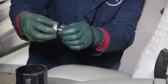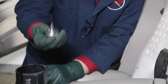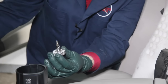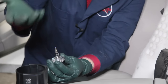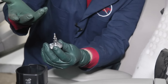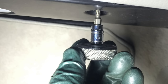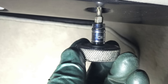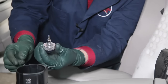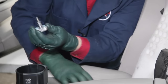Whatever type of light you use, get a big enough light to light up the whole underside of the dash — having good light is one of the best things when working under the dash. The third thing I'm going to recommend is one of these round ratcheting thumb wrenches. You might say you can use a screwdriver or a regular ratchet, but the problem is you often end up holding the panel or blower motor with one hand and working the tool with the other.